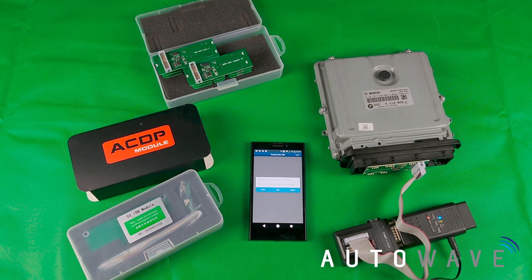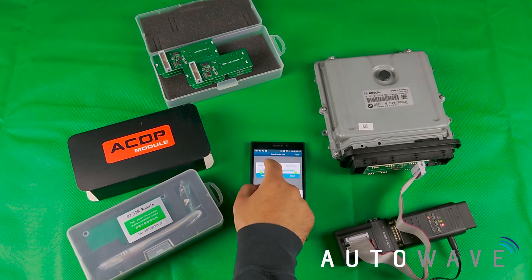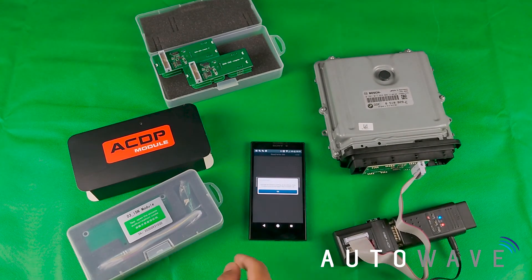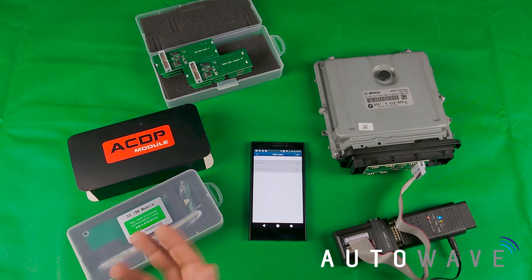With that ISN I can now copy it, or export it by saving it as a file. Save the file — that's saved. Hit OK and quit back out. Now I can complete my job on a lost keys BMW because I have the ISN, and I just proceed to reading whether it be a CAS, FEM, or whatever other immobilizer version is on there — I'll now be able to carry out a lost keys job.